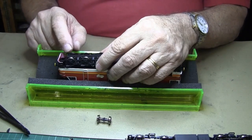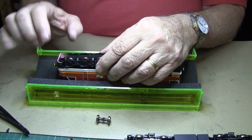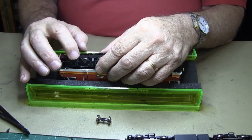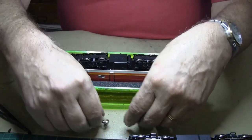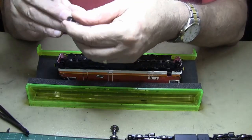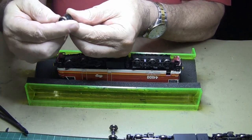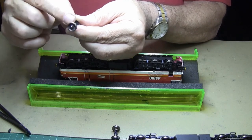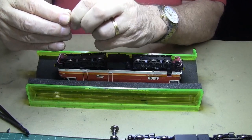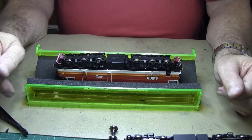Easiest way to test, put your finger on one wheel. You can rock it back and forth, but it won't turn. Do the same on the other side. Now, if it was split, what would happen is that you're rocking the gear against the center and the wheel will turn while you're doing it. It's running inside the gear. Split gear. So, yeah, it would need changing.